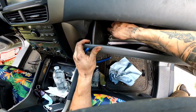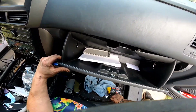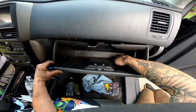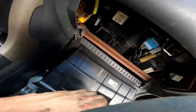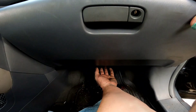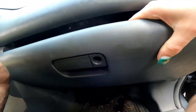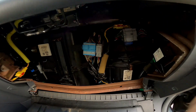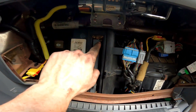Just like that, I'm going to pull it inward and then get this stuff out here so it doesn't fall on the ground. Here's our cabin filter right here. To get to the bottom, push this back up and then just pull it — it'll come out just like that. And there we are — look at all that!